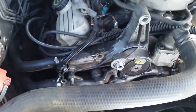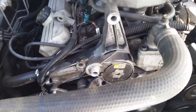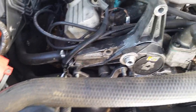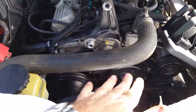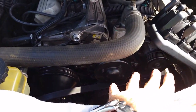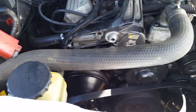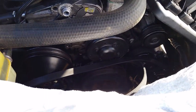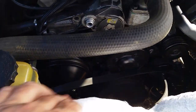The reason I'm making this is because this is the first time I've done it and I couldn't find anything on YouTube at all, so hopefully this helps somebody. So: disconnect the battery, take off the top four bolts, put the 15mm on the tensioner, and take a photo of how that belt goes on before you do anything. You can find images online but it's easier to take a photo — trust me, it's fooled many people.